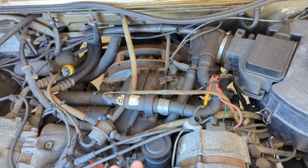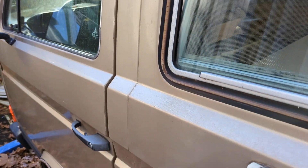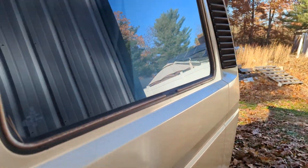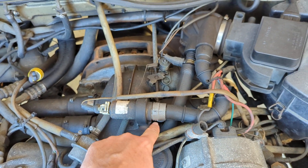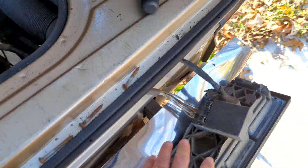If the throttle position switch is clicking, another test is to put the key in the ignition and turn it to just the ON position. The idle stabilizer control valve is supposed to vibrate. That's how it controls the idle air — it vibrates this electrical solenoid at a certain frequency that controls how much air goes through it. This is hooked to the air intake, and inside is a solenoid oscillating a certain number of times per second according to what the idle control unit is telling it to do.